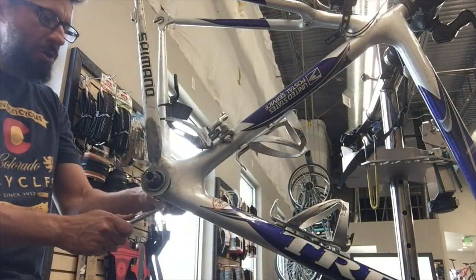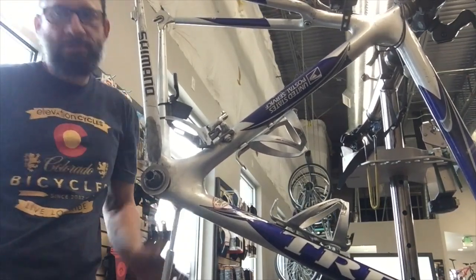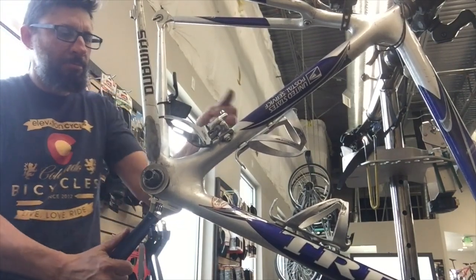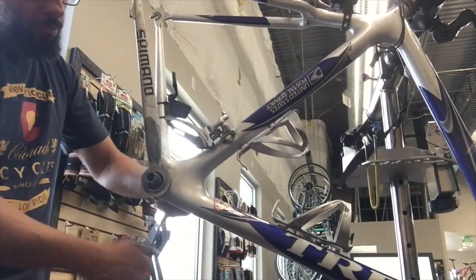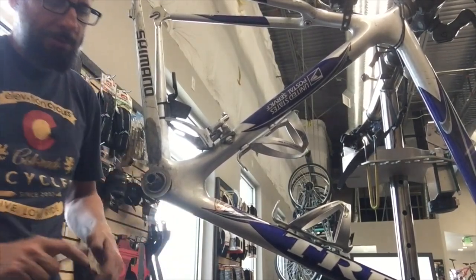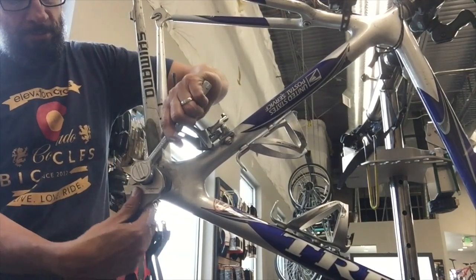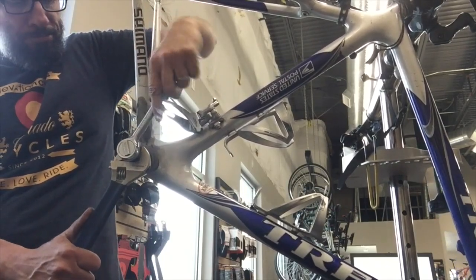Back to stripping the bits and things off the bike frame. These old splined bottom brackets — I did another video a little while back where I was testing a breaker bar. The thing I've found with a lot of these older ones, if they've been on there for 10, 15, 20, 25 years or so, they're difficult to remove the majority of the time. Not always, but some are definitely pretty tight. On the other side, I kind of formed a T-handle there with the socket wrench and then just an adjustable wrench, and that came off fairly easy.